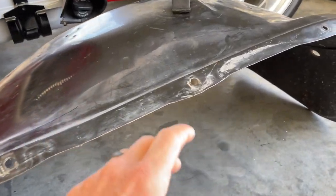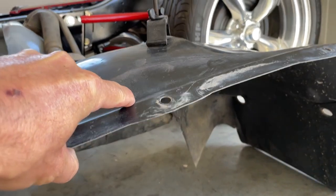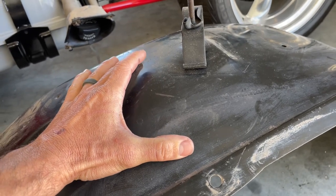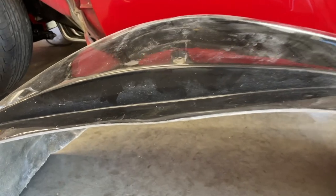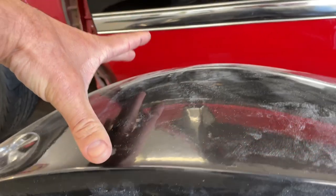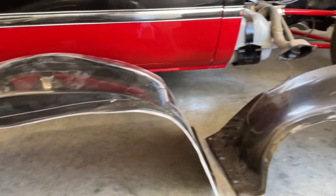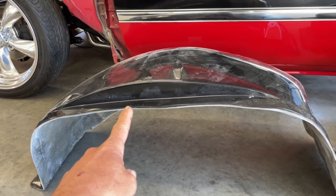The easiest way to tell the difference is from the mounting surface inside the fender — you'll notice the first thing it does is step down and then you have this small arch, which unless you're running bigs and littles like a drag setup, that's not super helpful. On our mild tubs, from the mounting surface, you gain a couple of inches and it goes over a foot across. So if you want to run a squared setup of tires, maybe 275s all the way around, this will give you the option depending on your offset.